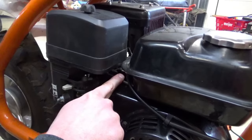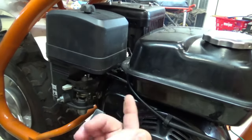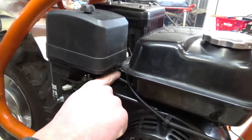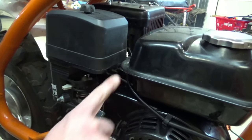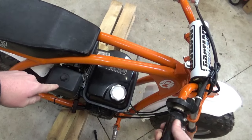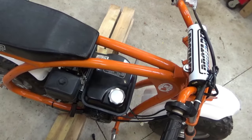And I take that stress away from that governor arm, which is under there. It wants to idle nicely. When I let go of it, it's pulling on that governor arm, making that engine want to rev up. And then what else I see when I pull on this throttle? Doesn't really want to rev up at all.